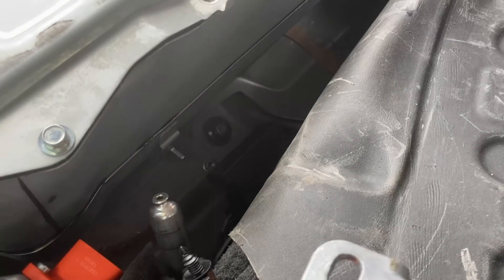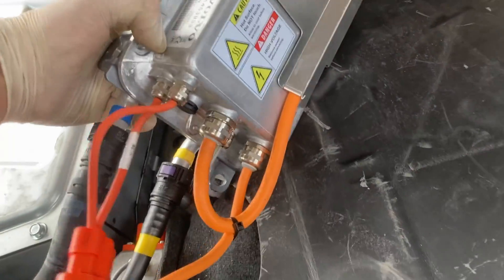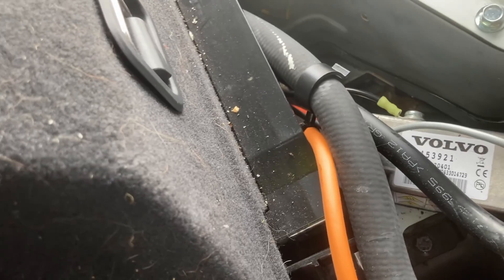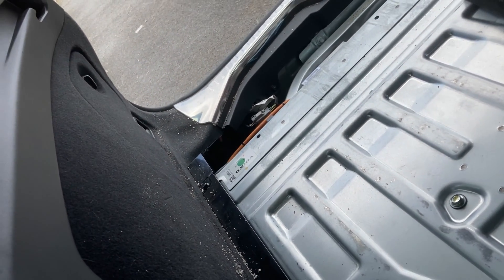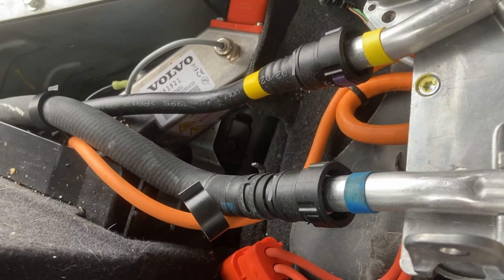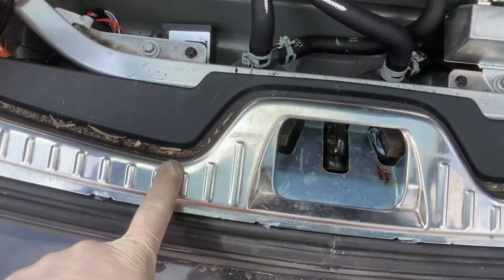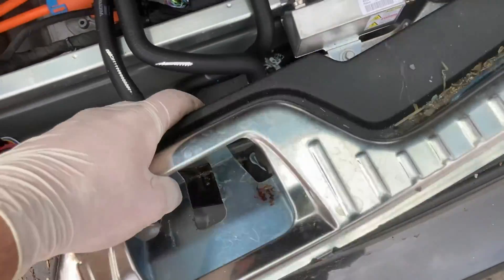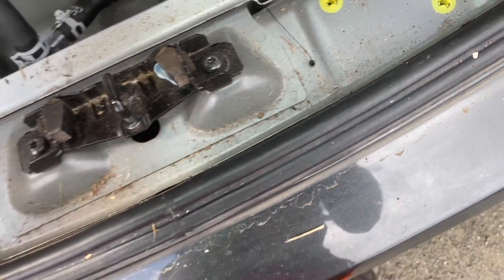There are the two studs at the bottom. If you drop one it's not right — you can get it back pretty easily. Just pull the bottom out and then lift it up. Set that aside for now, then obviously disconnect these coolant pipes. I'm hoping that if I remove this trim here I can pull these pipes all the way outside the car and drain the coolant there, which should be easier and less mess. To get this piece out of the way, just loosen but don't remove the two 8mm bolts either side, and it just lifts off. It's got little spreader clips inside so you just pull directly upwards.